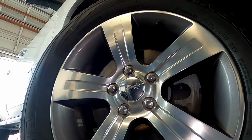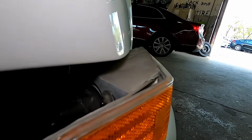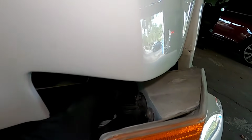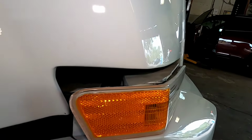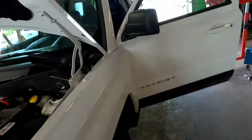So let's go ahead and put the bulb back. Get my knee to hold this back up here. As you can see, this comes with a plastic. You just push on it and peel it out like this. It's not a big deal. So you just want to keep on turning it to fall right in. Once it falls right in, go ahead and turn the socket, push it in and turn it clockwise. Go ahead, lock this into place, and what would be the next step is to test your light to make sure it works. So let's go ahead and crank the vehicle up.